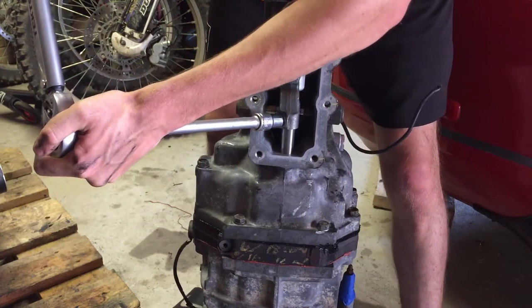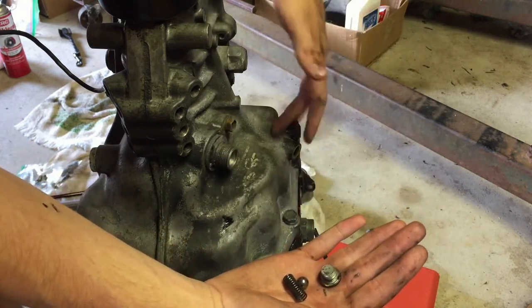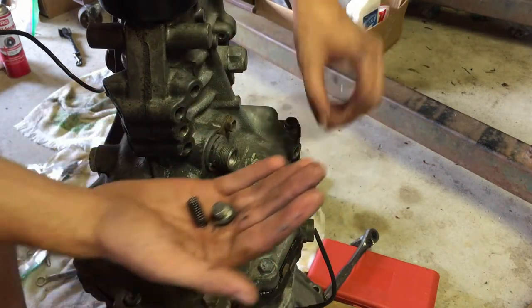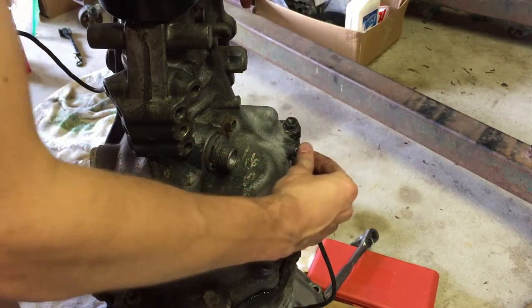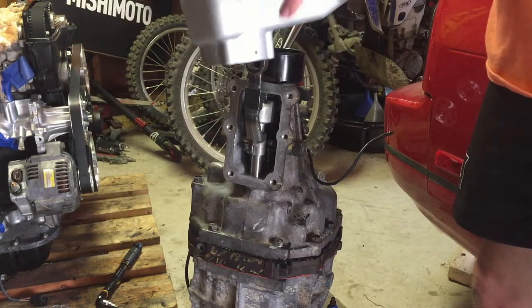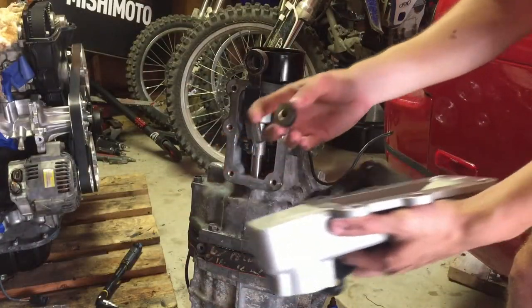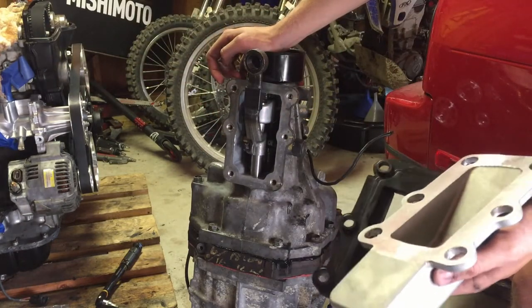Now what you can do is install that one bearing and spring retainer Torx head bolt that I was talking about, and it goes into this hole right here. The ball bearing goes in first, then your spring, and then your bolt, and it gets torqued to 18 foot-pounds. All right, so I've gotten those Torx head bolts torqued down, and at this point, you're going to install your shift linkage housing, which consists of a little oil baffle plate, which fits right on here just like that, and some of these little retainers that go into these holes, and it just slips right on here. So we are going to go ahead and install that as well.